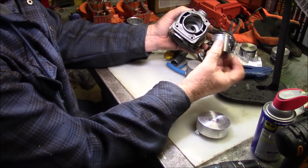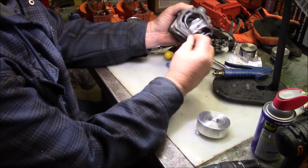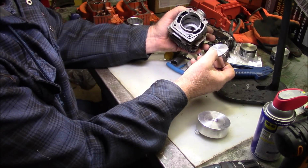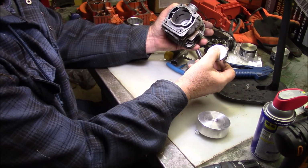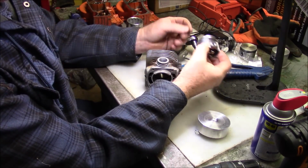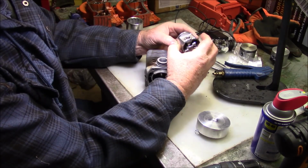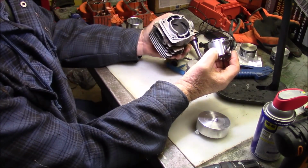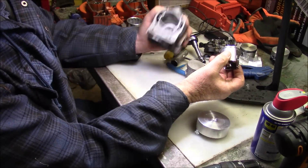When you have a piston in a cylinder and you have a lot of heat in the combustion chamber, which is a fairly localized area, a lot of that heat is pushing on the top of that piston and gets into the piston where it swells. Well, how does that piston cool? Well, a lot of the way that piston cools is through contact between the piston ring and the sidewall, right? Also just from the piston itself and the sidewall, but the ring plays a big part in that.